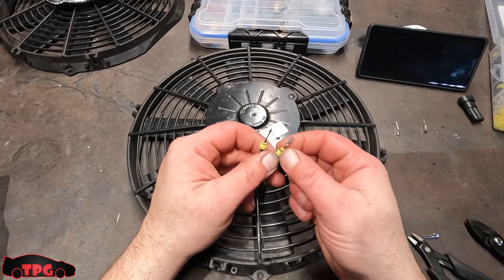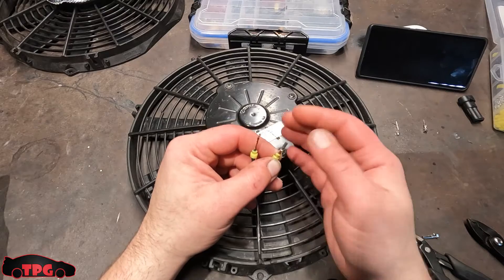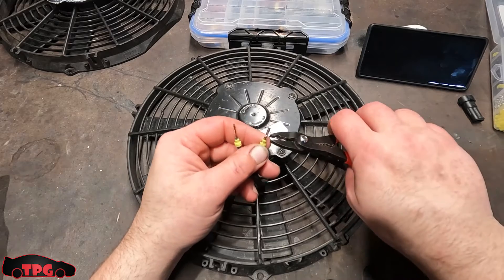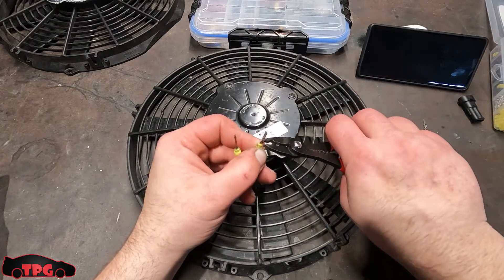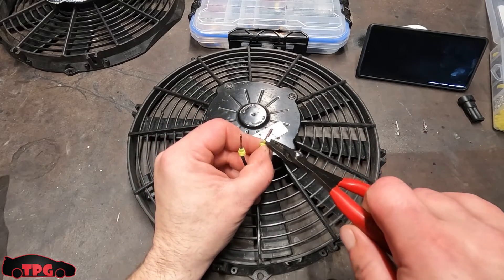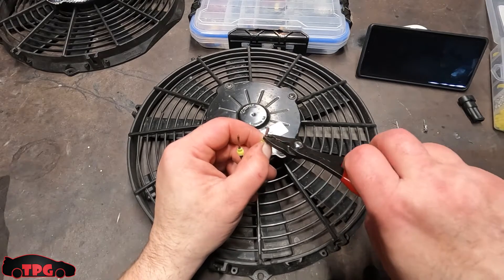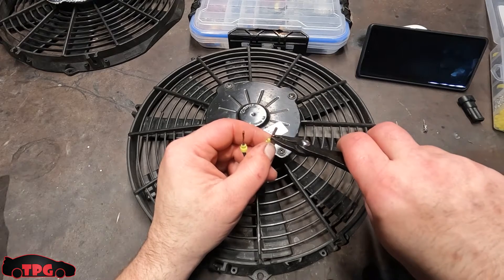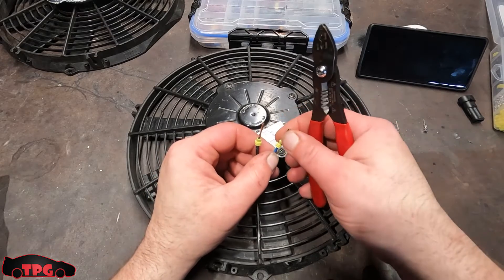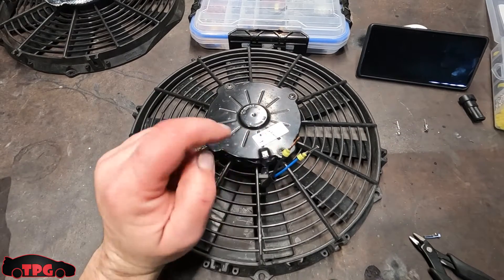Now that the connector is hooked up to the yellow insulator, there are two more little ears on the inside — we're going to crimp these tiny little ears over onto the wire strand itself. Just squeeze one side over, overlap the other side on top of it, and give it a little crimp with the end of the pliers to squeeze it nice and tight. That's one side done. We're going to do the other side — first line things up and figure out how much length we actually need, then trim the excess.